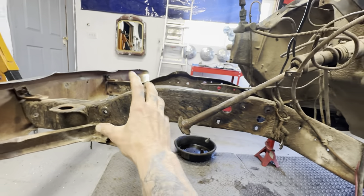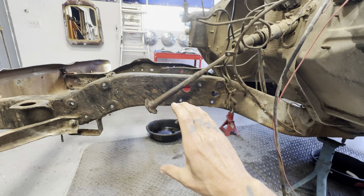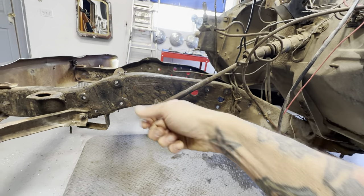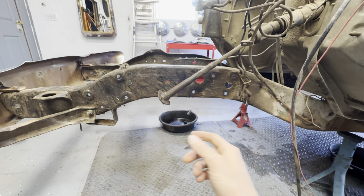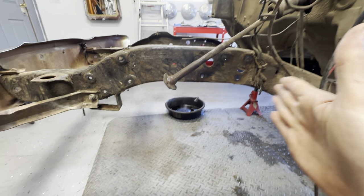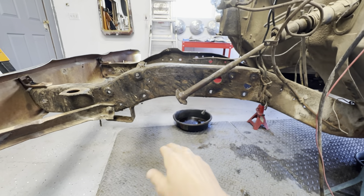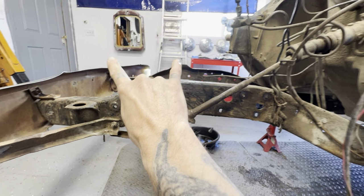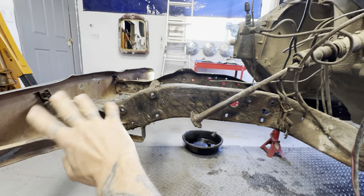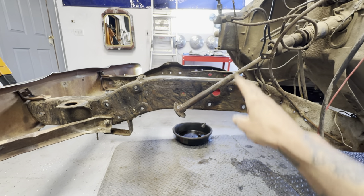What's next? So then of course your steering box and all your steering linkage is going to be two inches too low, and that's going to cause bump steer. Because when the wheel goes up, now it's going to be pulling on the tie rods and it'll cause the wheels to either go in or go out depending on which way you are. If it's too low, they're going to be too short already, so it's going to cause toe in. When you hit a bump it's going to cause more toe in every bump, because the rods are below. So you need to bring that up.